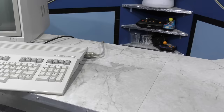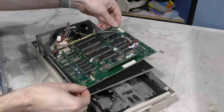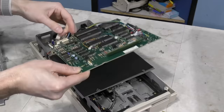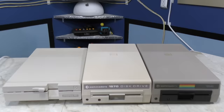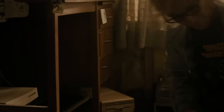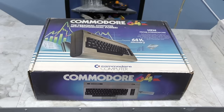During the early days of the 1571, Commodore was having trouble keeping up with the demand in some regions, so as a stopgap measure, the 1570 was born. It used the same case molds as the traditional 1541, but on the inside the board is essentially a 1571 board being held in place with some custom brackets. The drive mechanism itself is still a single sided drive with just one head, but it does have the faster burst mode for the C128 and also includes a track 1 sensor. So it's very much a hybrid between a 1541 and a 1571. The 1570 is pretty rare these days as it wasn't made for very long. And interestingly enough, you can actually see a 1570 on the floor in the movie Ready Player 1.